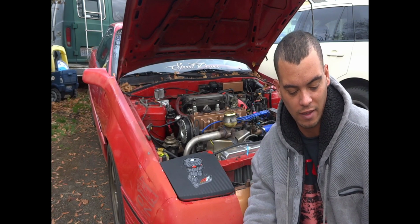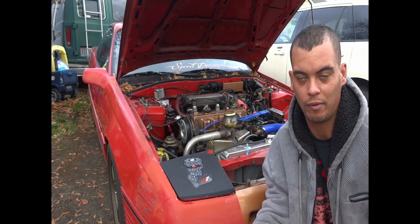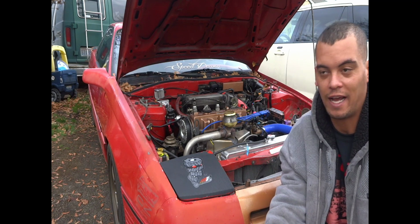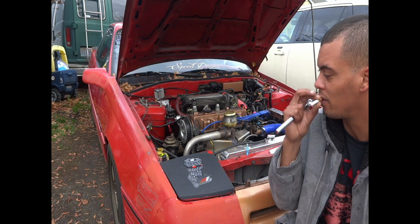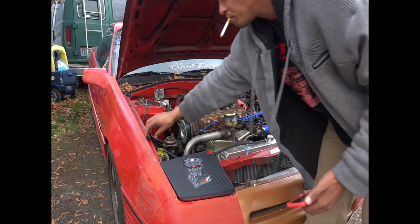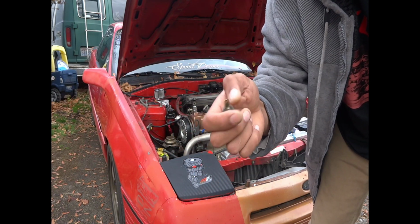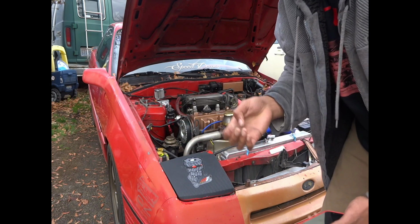So today I've got to replace the fan switch on the probe, because the tab for it that actually goes to the switch is faulty. I don't know if you can see it in the video, but it's really loose. Whereas here's a good used fan switch, which has a nice strong tab on it. It's still in good shape.